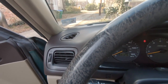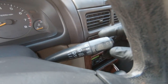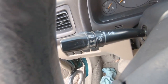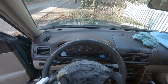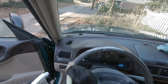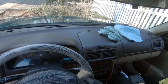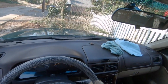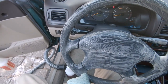Now to go along with it we have their conditioner. Do you use this on the steering wheel itself? Well, let's see. When you have a steering wheel like this you could just simply attack it with steam, but again steam and high alkaline cleaners could cause some damage. So when cleaning areas like this on older vehicles, just use caution. Use the least aggressive method first. This cleaner is perfect — it is a very powerful cleaner and yet it is very safe and gentle. We use a detail brush and just work that cleaner into all of those areas, and you can already see that the lather is turning brown. We're going to have to work in layers; this is not going to remove it in one shot. We're going to have to continue to work at removing layer after layer of makeup, grime, and oils. So it may take some time, but be patient. This is going to be the gentle way of cleaning these areas.